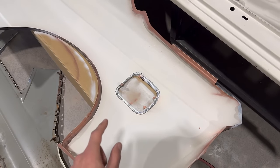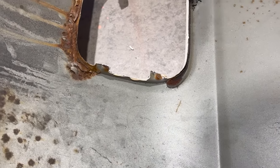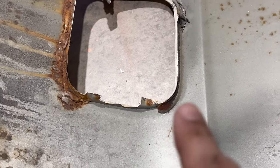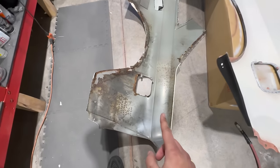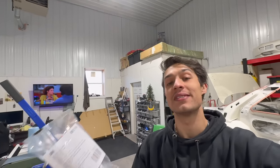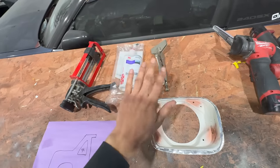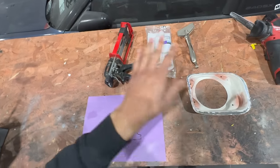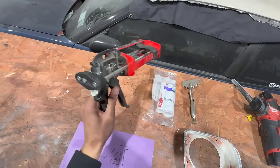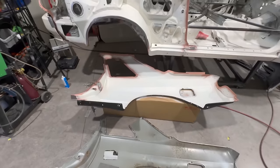The surrounding area gets some sealant. You guys can see from factory they just apply it right over the e-coat — that's the sealant, just some seam sealer. So we're actually going to use the good stuff. If you're curious what the second product I was talking about in the last video is — it's 3M Panel Bond, the 08-115. Great stuff, guys. I'll have it linked below. However, you do need a special applicator gun, which is about $100 on its own. We're going to use that to apply this to the quarter panel and seal it up to the inner wheelhouse as well.